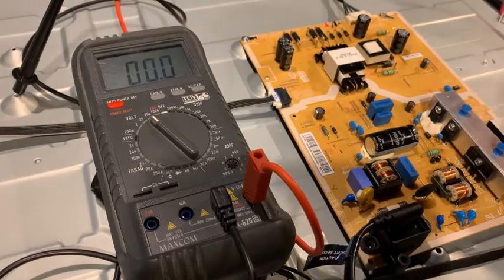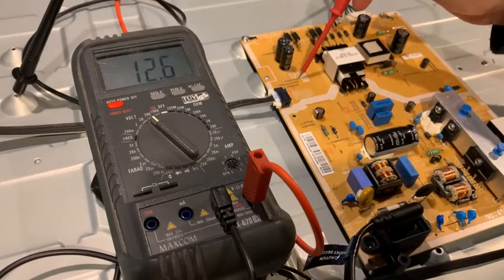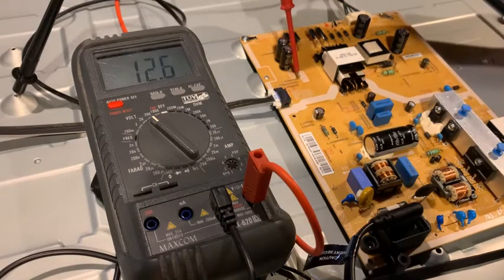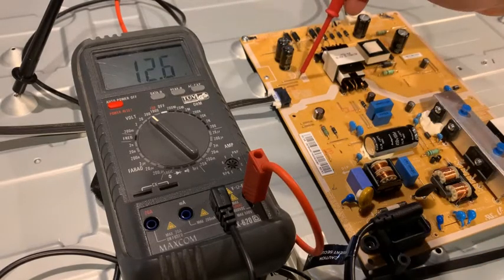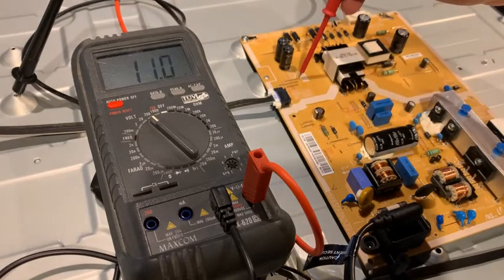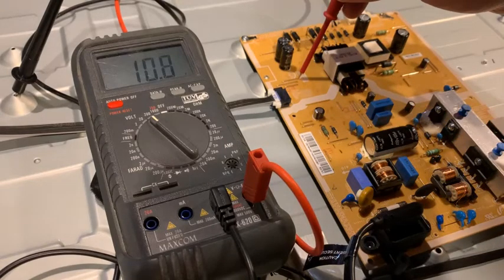You want to measure a few points. The power is on. On this specific one I see a checkpoint — standby is 8 volts and operation is 13 volts. I'm reading 12.6 volts, so it's on. If I switch the TV off it'll drop down to 8 volts. So this works.